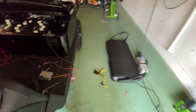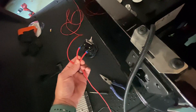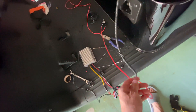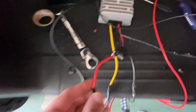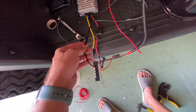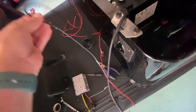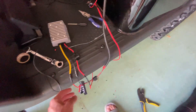The red positive wire goes into this switch — just in and out — with spade connectors on that, and then it goes directly into the positive on the reducer. The negative on the reducer goes directly to the battery negative, a home run all the way back there. Then we have the output side, which is 12 volts.